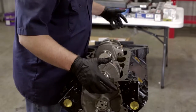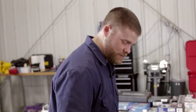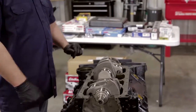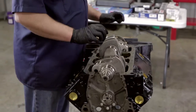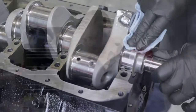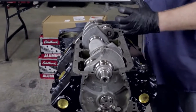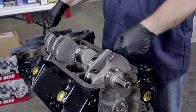When laying it in, grab it by the ends and lay it into the journals as evenly as you can to make sure everything lines up and you're not kinking or pressing on the bearings in an odd way — make sure it lays in flat. We'll clean off all the tops where we're going to lay our plastigage in, then button up some main caps and check our clearances. One important point: this is a dry fit test for clearances, so there's no oil or lube on any parts in contact right now. You're going to want to avoid twisting and spinning the crank any more than necessary since the bearings are completely dry.